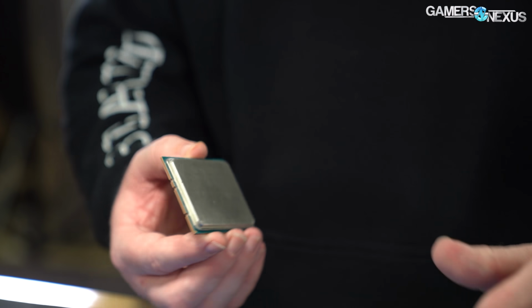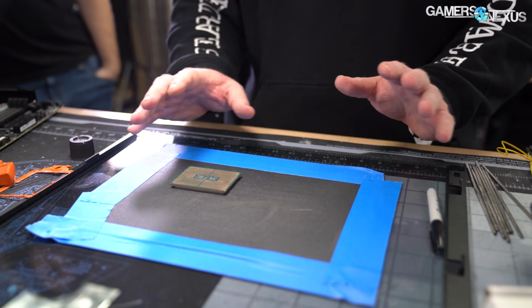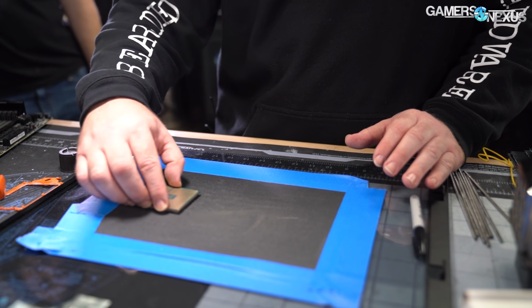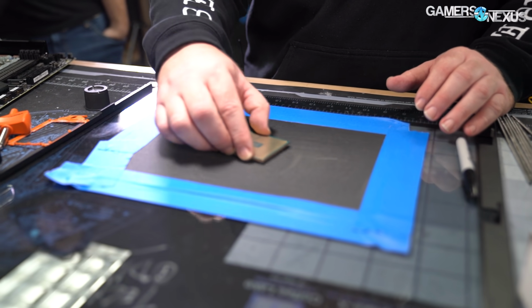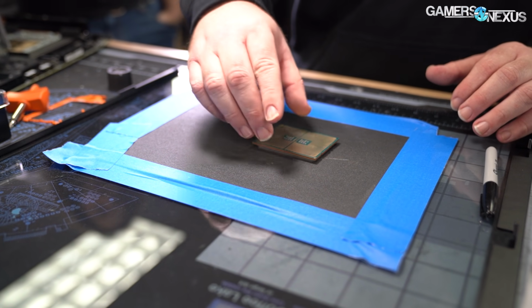How about pressure? How do you apply pressure? Just light. It depends on the CPU. I try to do barely any pressure. Okay. Like you're just dragging it on the surface? Just dragging on the surface, just a little pressure, and just periodically changing the motion.